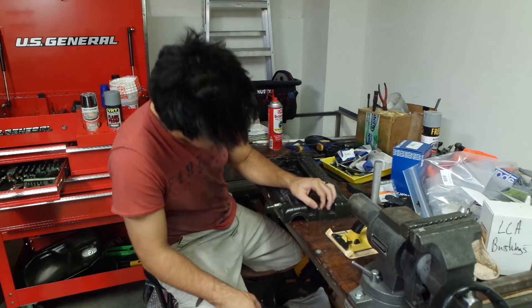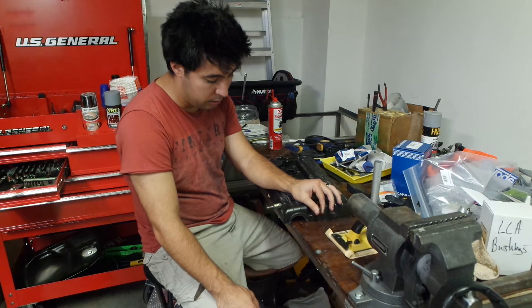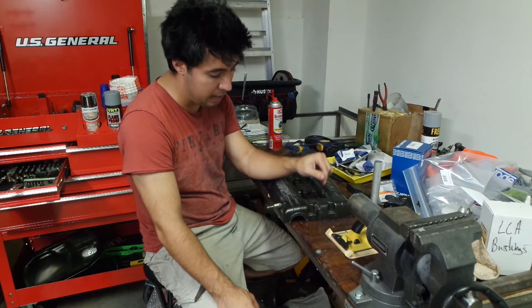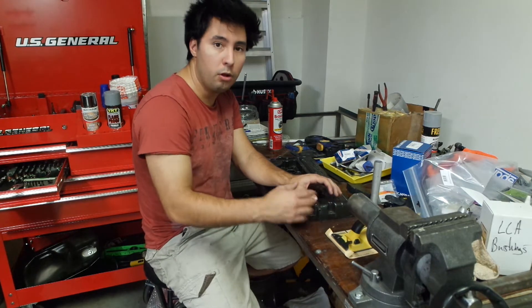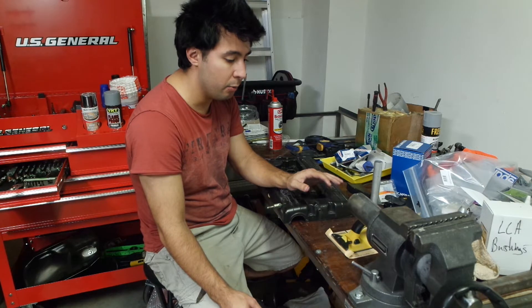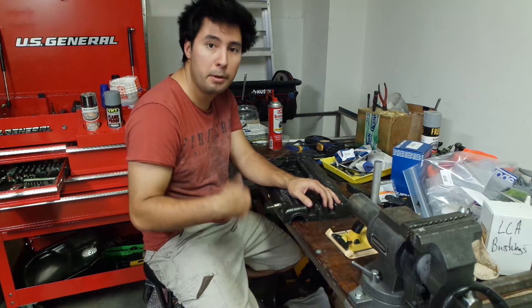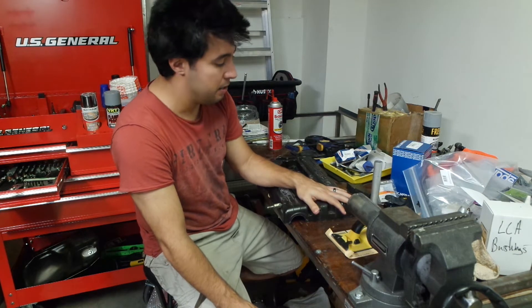These are relatively small — maybe a quarter-inch opening. I'm looking to maximize and really open those up. My plan is to actually get rid of the check valve and have a full vacuum on this side of the valve cover to pull all the vapors that come through here, and hopefully put a vacuum in the crankcase so that we're not blowing out any seals, and any blow-by that happens on the cylinders — especially during warm-up or when pushing higher boost — will be pulled by this.